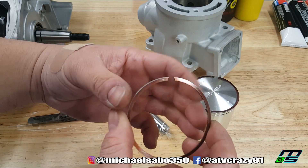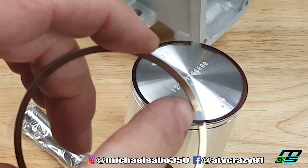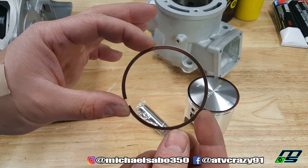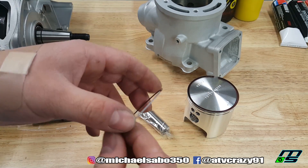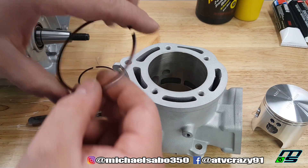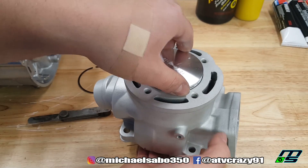When this ring is compressed — now the way to check that is fairly easy. Just a note real quick: whatever side of your piston ring has the manufacturer markings is the top of the ring, so you can see this side doesn't have anything — that's the bottom, and that little end indicates this is the top of the ring. But regardless, we're going to take our ring and put it in our cylinder. And before I go sliding that in, I'm gonna put the piston in — this is going to help us square up that ring. I'll show you what I mean in a second here, so I'm just gonna gently slide this piston in.